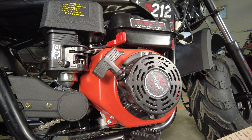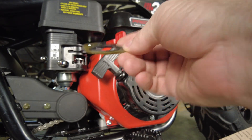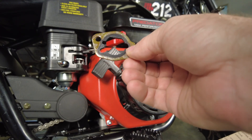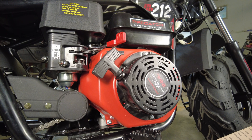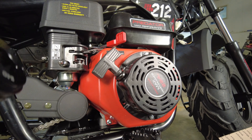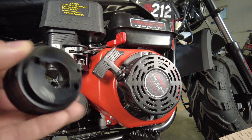In the last video I tried getting the lighting coils up and running on this Predator 224 and we hit a little bit of a snag. I'd also tried installing a Stage 1 kit on the 224 and hit a small snag. What we have here is a spacer with a rubber gasket built into it from a Predator 212 — I found these from Dino Cams, link in the description, not affiliated but handy to have. The problem is the kit is for a Predator 212, and because this is a Ducar engine, the airbox is just a little bit different, so the airhorn was interfering with the choke arm. I think we're in good shape now — I've got two of these spacers plus some gaskets so we should be able to space this out from the engine adequately.